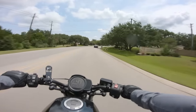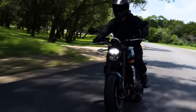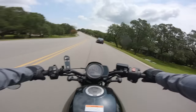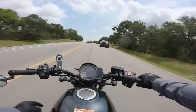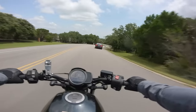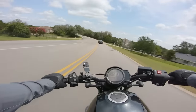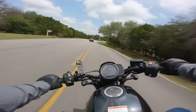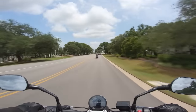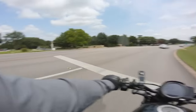That is the right sound for this bike to make. When you're on it you can hear it a ton, but rolling behind you it's not droning or making some crazy sound — it feels like just a good cruiser exhaust. We still retain the resonator in the mid-pipe so there is some good back pressure going on. I don't feel like it needs a tune — the roll-on on this motorcycle is always a tad herky-jerky, and it's still a bit herky-jerky, but maybe a tune would help smooth that out a little bit.